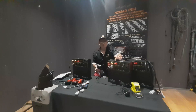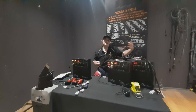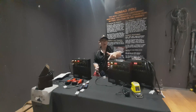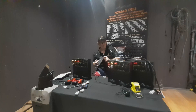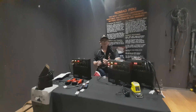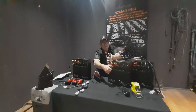If the light goes green on the charger and the Nomad is saying 12.1, I know that green means not charging — as opposed to what people think, that green means it's charging. It's not. When the red light on the charger is red it's charging. If this charge light goes off and the reading is 12.1 or 11.7 and the charger is green, you pretty much know the charger is faulty. That's a test you can do: run the Nomad, take all the loads off, charge it, and if the light suddenly goes green but only shows 11.8 or 9 volts — pretty much it's the charger. With a diagnostic tool I can tell straight away if there's an issue with this charger.